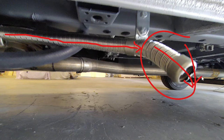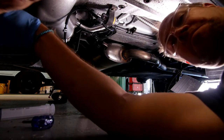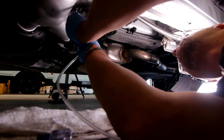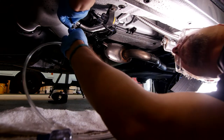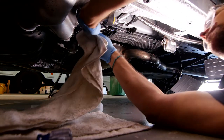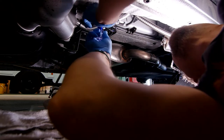Here's a big tip: once you get your fuel hose routed, it's a really good idea to prime it. Simply disconnect the fuel hose connector going onto the inlet side of the pump, then use a large syringe to pull fuel from the fuel tank through the filter through the hose up to the pump location. Then reconnect the fuel hose to the pump and re-tighten the hose clamp. By priming the line like this it's much more likely the heater will fire up the first time, because if you don't do this you'll most likely get a series of faults as the fuel pump tries to displace the air in the fuel line.